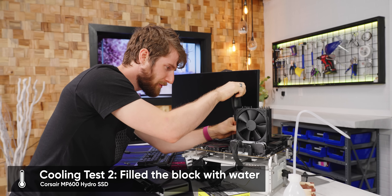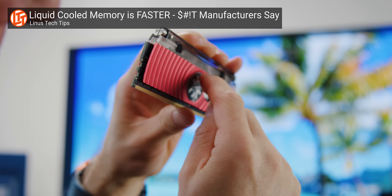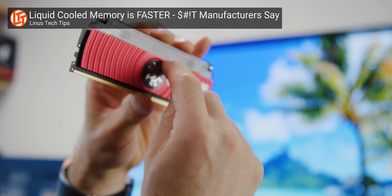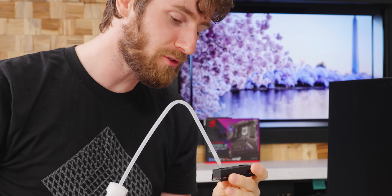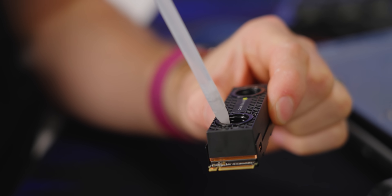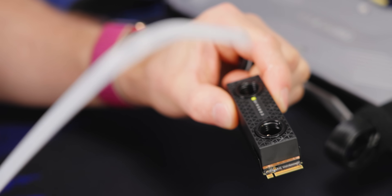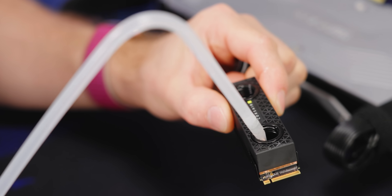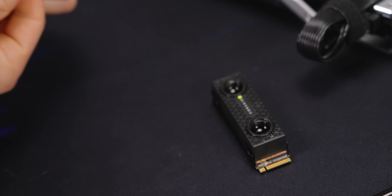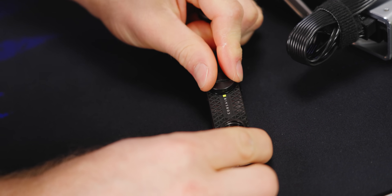Let's add water cooling. There are a lot of different ways to water cool a product. Remember that water-cooled kit of memory that just had water in it but wasn't actually circulating? I have a theory we could get away with doing something similar here — just filling the SSD block with water and sealing it up. What we're doing by throwing water in here is adding thermal inertia, making it so that when the drive is under heavy load it takes a lot of thermal energy for that water to change its own temperature.